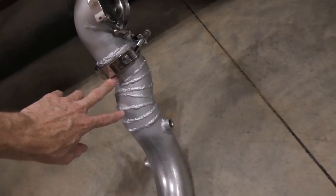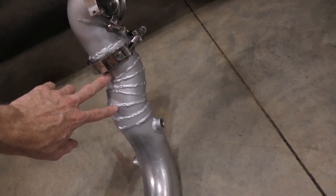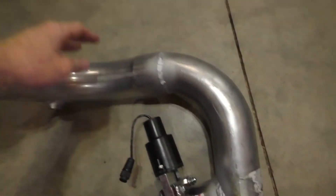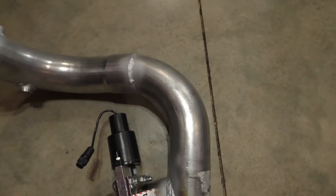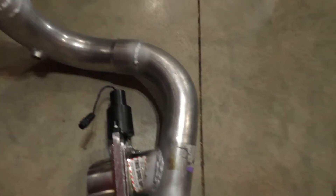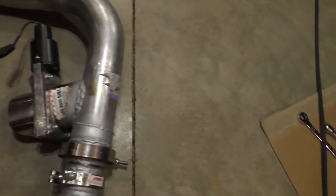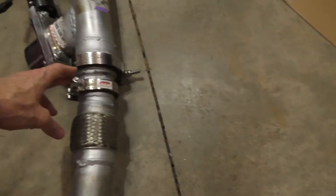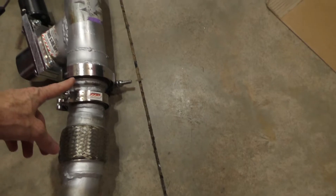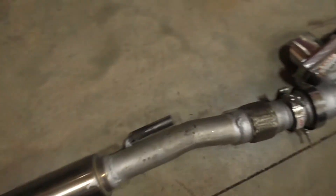The reason for the pie cuts is to clear the front driveshaft. The oil will drain over that panel right there, which is unfortunate. Then I welded the cutout on there — three inch — and here's the two-and-a-half-inch pipe I already had, so that's a reducer. I'll still be able to reuse my flex pipe, and I welded my hanger back on there.